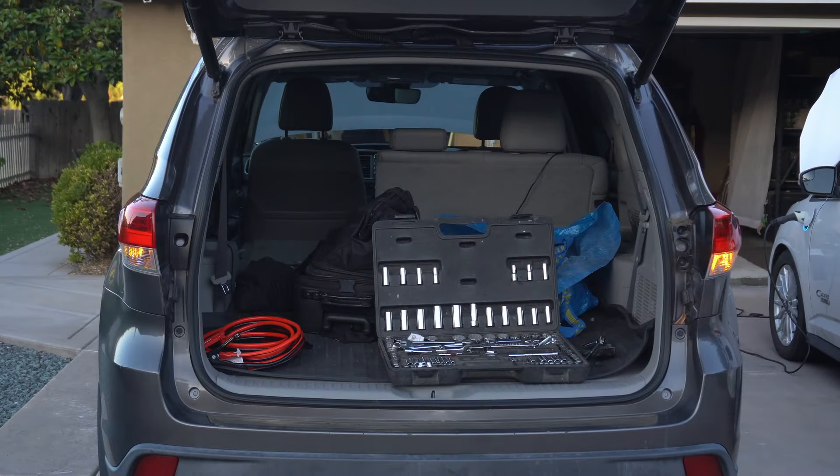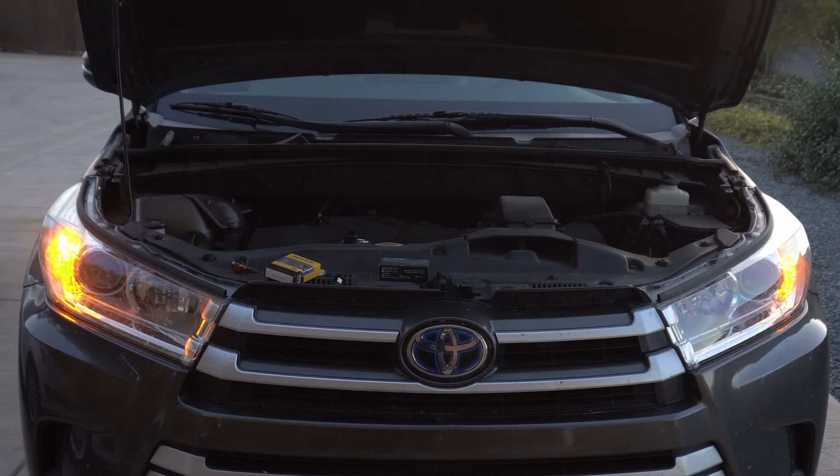So here's standing behind the vehicle — you can see the new bulb is on the right, the left one is another LED that I've used previously that I had installed resistors for. These new ones are really, really bright, so that's probably helping to draw more power, which also fools the car again into thinking that things are working well.